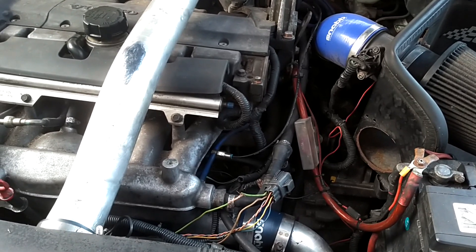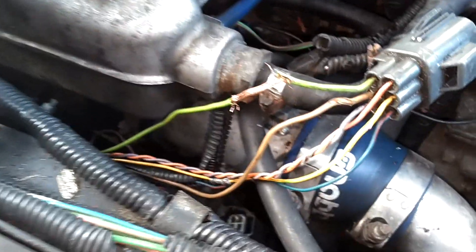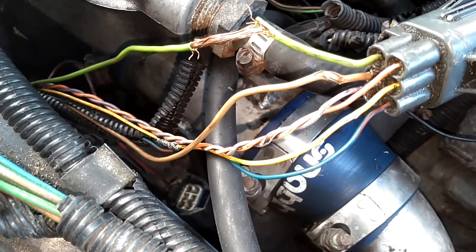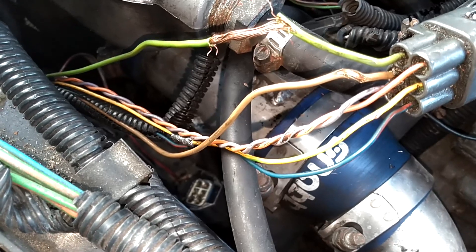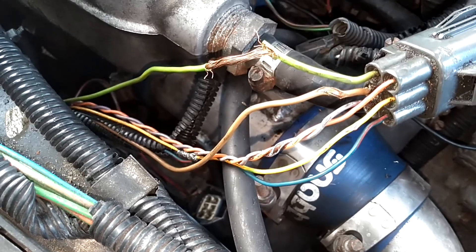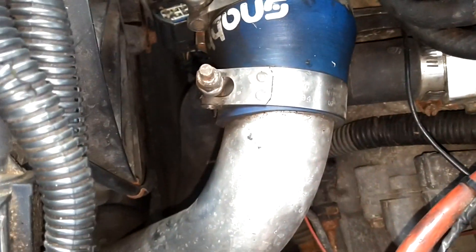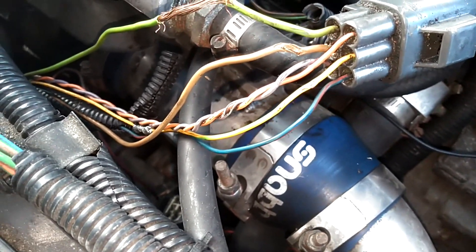He's having some problems starting, the throttle's a little touchy, and there's some damage on these wires. Somebody changed the starter, and the ETM wire harness is not properly attached to the wire harness in the car, which it should be but it's not. When I started the car I heard a clicking sound. When the fan kicked on, I came out here and found these wires are in the fan trough, being eaten up by the fan. If they were properly in the wire harness, that's not even possible — but since somebody has them flapping around in here, that is possible.